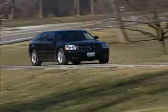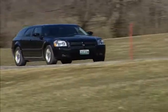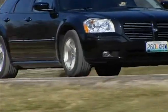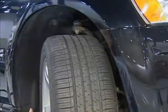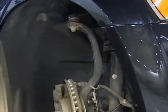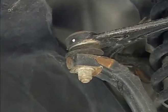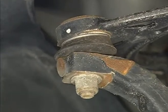Multi-link or wishbone suspension inspection. Modern multi-link or wishbone suspensions feature excellent ride, handling, and improved tire wear. The steering knuckle has been extended to raise the upper control arm position. The upper control arm holds one or more follower style ball joints.